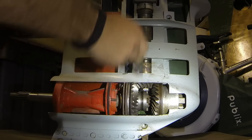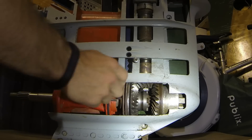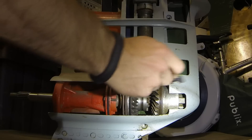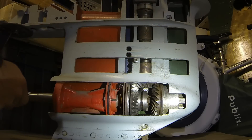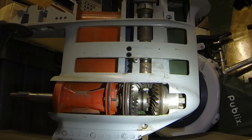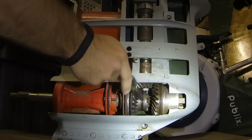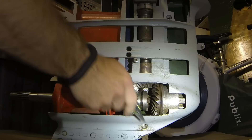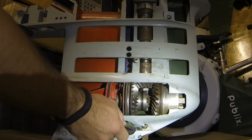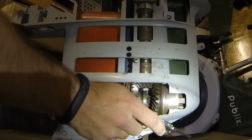On this side of the seal we have all of our gear oil. Seals are really important here — if a seal were to fail, you would have gear oil leaking out into the water and water leaking into your gear case oil. Water is a very poor lubricant and would tear up these gears very quickly, so you want to keep good gear oil in here.